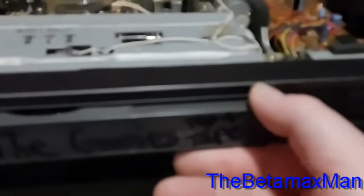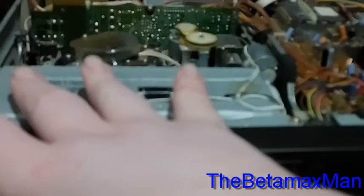Yeah, it'll work there for a second or two. Let's get the problem remedied — the servo. Part three, we're going to take care of the drum servo. At least right now we've got a really good start on getting this thing to function 100%, because it is now doing all the functions: playing, rewind, fast forward, loads and unloads fine. Mechanically it's in great shape — 100% working. It's got some electronic issues we have to sort out.